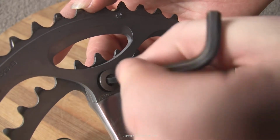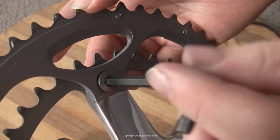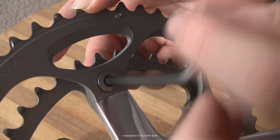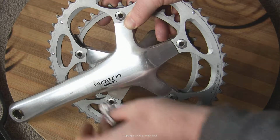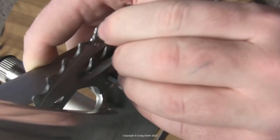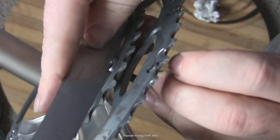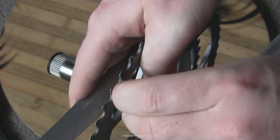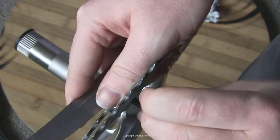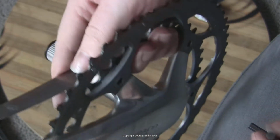And then as you proceed to actually tighten them down, you should do it in a sort of star pattern. Don't just work your way around in a circle. At this point you could wipe off excess Antiseize as it's squeezed out. You don't need to overtighten them. Remember, these nuts are just holding everything together. They're not actually taking any force or load when you're pedaling. And again, you may need to use your knife blade or the special tool if you have it to hold the nuts, but in my experience they bind sufficiently well when you're tightening them that they don't turn.